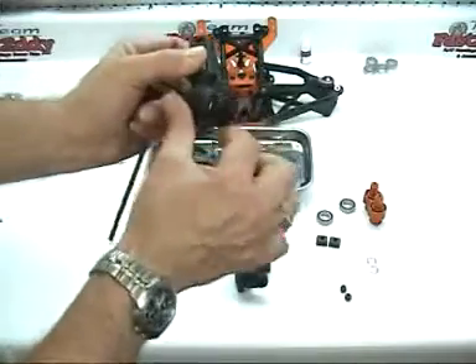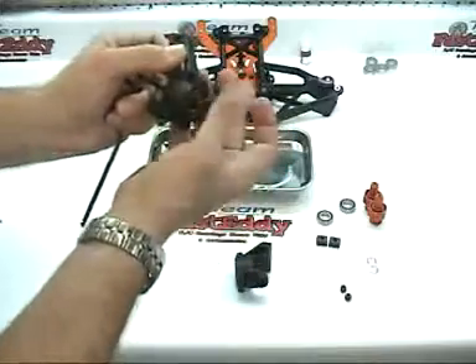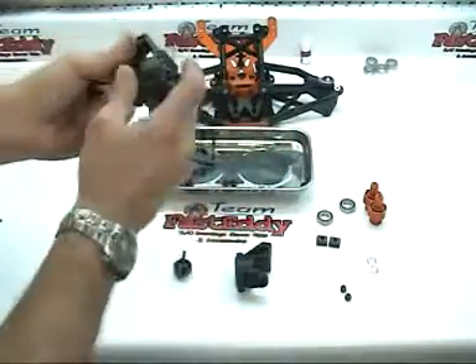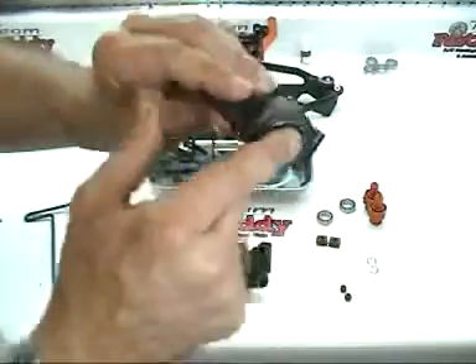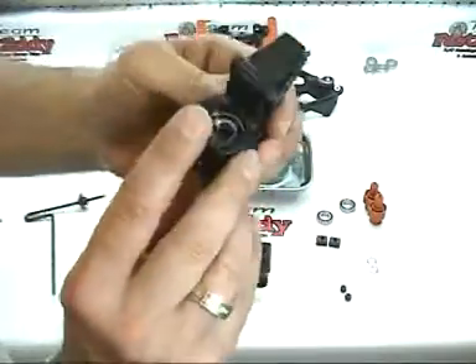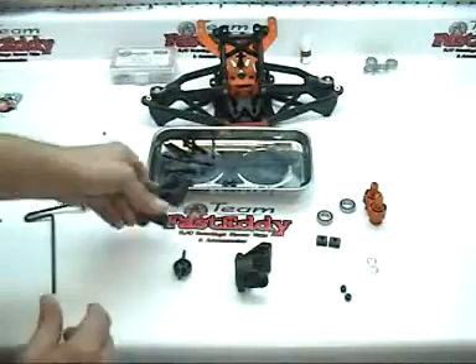Very simply, just hold the back with the Allen wrench and go ahead and remove the winged portion of the press, then slide the second portion out from the back. Let's go ahead and inspect the wheel hub — make sure that the bearings are all in straight and proper, nice and flush, and that they're working smoothly. Let's go ahead and do this again on the second side.